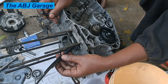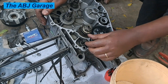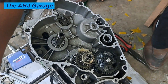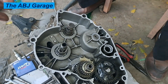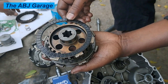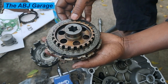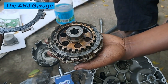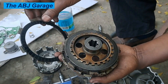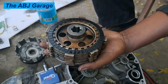Here you see us assembling the belt tensioner. On one side it has a lock on the lower side. Then proceed by installing the clutch — the clutch has a washer and a spacer to be installed. This is a multiple disc type of clutch; it is a wet type clutch that is operated by spring pressure and is always lubricated with oil. Go ahead and arrange all those, then install the clutch housing onto the shaft and install the springs and spring seat assembly.